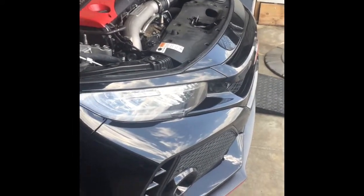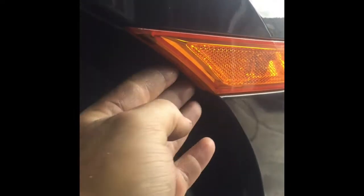Start it off, I'm going to take the front bumper off, and you're going to want to come in the fender well. There's some Phillips screws. I believe there are 4 or 5 of them on there. You don't have to take the highest one off, it actually goes into the fender. But I like to do it just so you can peel the plastic back and get to the corner marker a little bit easier. So I'm going to go ahead and take those out.